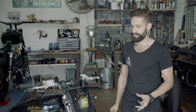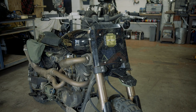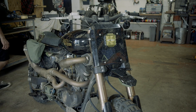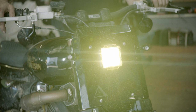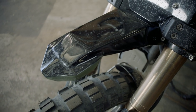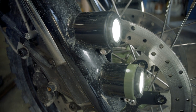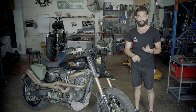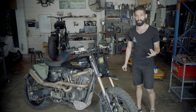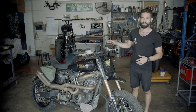The front end on this bike is a really pivotal piece for me. I wanted to make sure it had a really aggressive look from the front but also function as we wanted it to. Being a heavy bike, I used a large capacity Triumph Tiger front end — upside-down 56mm forks with the Triumph triple clamps modified to suit. A front scrambler number plate, LED lights, and a handmade aluminium front fender. An idea I had early on was to create a motocross style fork guard and have the lights integrated into that for my low beam. Swapping the front end out also gave me the opportunity to put alloy rims on it, lightening the front end and using a twin disc setup, which helps with the front brakes immensely. Linked up to an ISR front master cylinder, and we also use the ISR clutch lever as well.